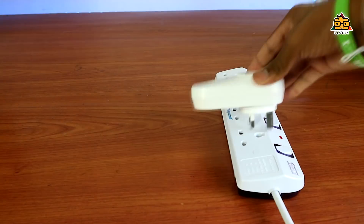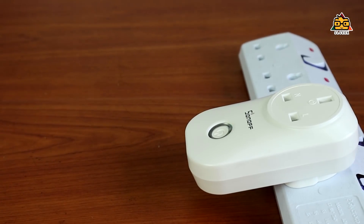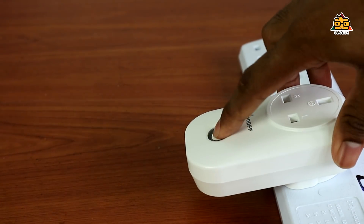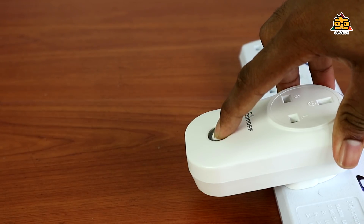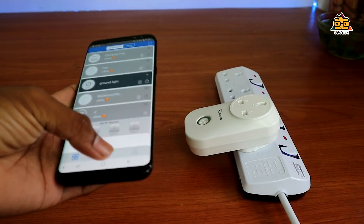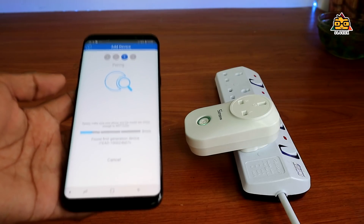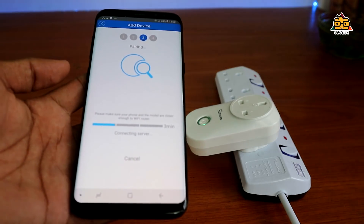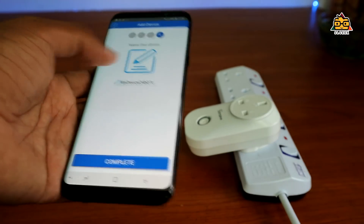You can plug your device in. You can see the light type. Then press the button and the light will blink. So, if you don't have your switch set up yet, you can link your device to the eWeLink application on the phone. Now you can add the WiFi and password. You can click on the next button and register. If you want to register, you can press the switch.